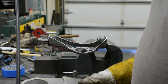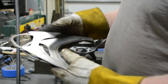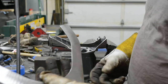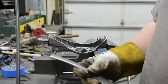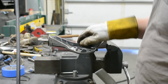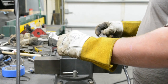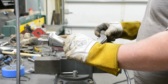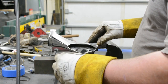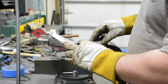We made the cardboard template, put it on the program, did a number of different trial pieces dialing in the fitment, and after four tries we got a successful piece. I was cutting those out of 18-gauge to not waste material, but the replacement patch panels are going to be the same thickness as the control arm — I measured it and it looks to be about 12-gauge, so we got a 12-gauge filler. The control arm has some bends in it, so my main priority is to get it fitting nice up at the top, tack it in there, and then basically work the metal into the shape.